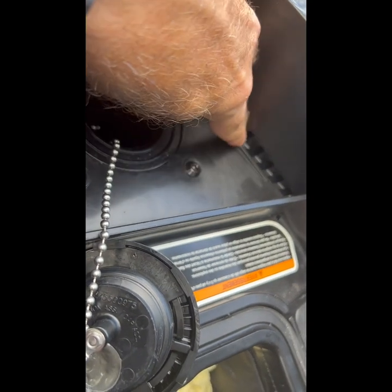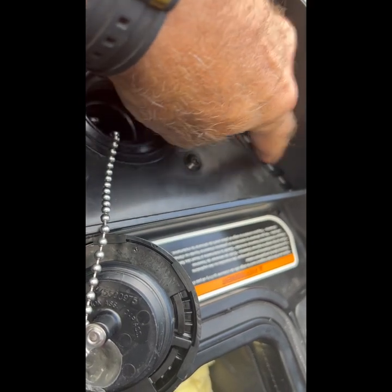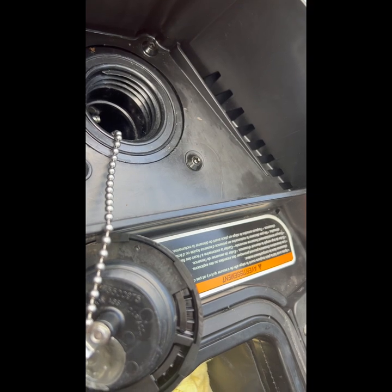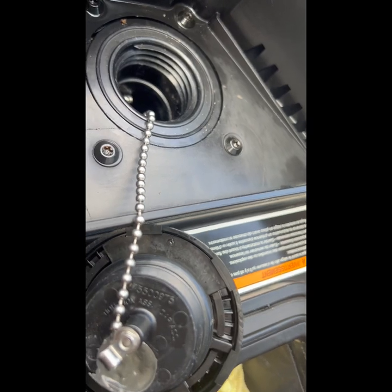That way you won't have an explosion. If the cap is your vent and you start venting gas, then you have a place for the fumes to go — and that's Sea-Doo's answer. For mine, it's underneath the ergo panel, which is outside of the ski, and you're using your P-Trap.